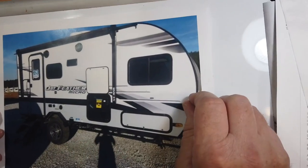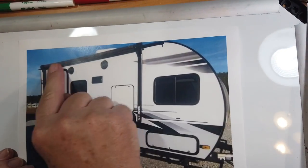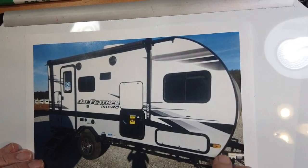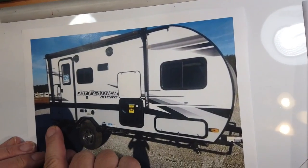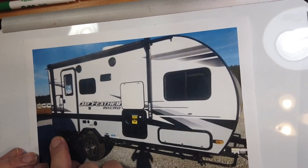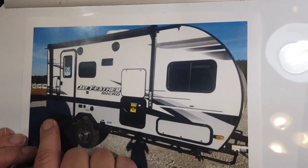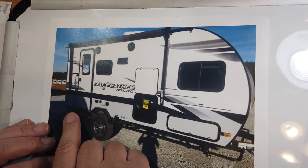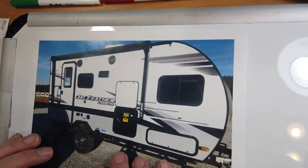There are two possible areas for mounting. The top of the RV is plastic, so it's not a good ground area at all. If you put an antenna on it and run something down to the chassis and bolt it back with a good bolt and a star washer — make sure it cuts through the paint — you've got a very long ground run compared to your antenna.